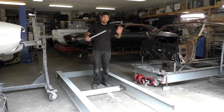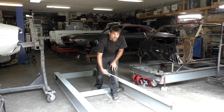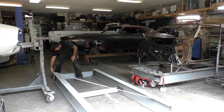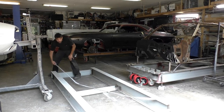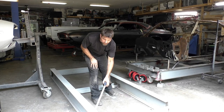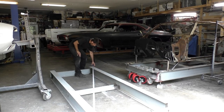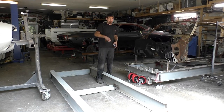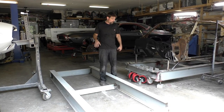This is key on the frame jig: you have to make sure the frame jig is square as you're tacking it - not when you weld it. We tacked it and basically measured corner to corner. We got 130 and a quarter, and then you're going to take the same measurement on the other diagonal. As you're tacking and before you weld, you're going to square up your frame jig and make sure you're perfectly square. That's the key to everything, because when you put the car on it, you want to make sure everything's square so you can take your measurements.